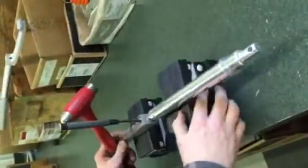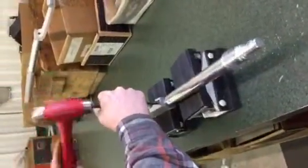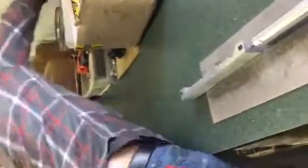And it's going to appear just like this. And more than likely what you'll have to do, if you're replacing the cylinder, is take it over and knock it out with your 5/32 punch. Makes it a little bit easier if you have something here to hold it up. And your roll pin's out. You can change it out. This one's already a good cylinder, so I don't need to change it out. I was just showing you that for your sake.